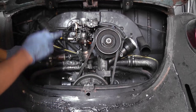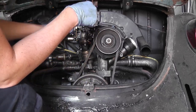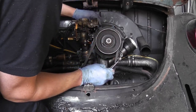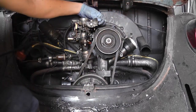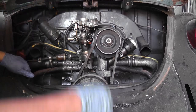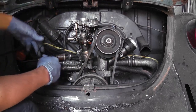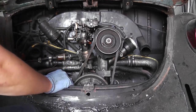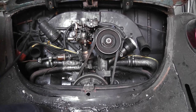Next thing we're going to do is remove the carburettor. We'll start by taking the vacuum pipes off — our fuel cut off and electronic choke. The electronic choke is banjaxed. It's actually an electric heater element — as it heats up it opens the choke. When it's cold the choke is closed, it heats up via a bi-metallic coil — it's actually very clever how they do it. But in this instance it's bunched, so we'll need to be addressing that at some stage.